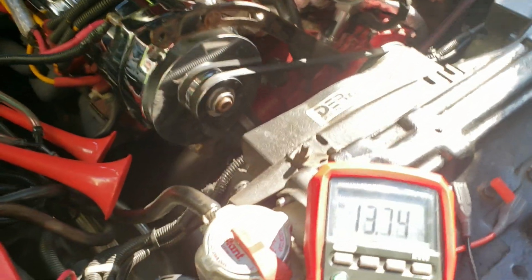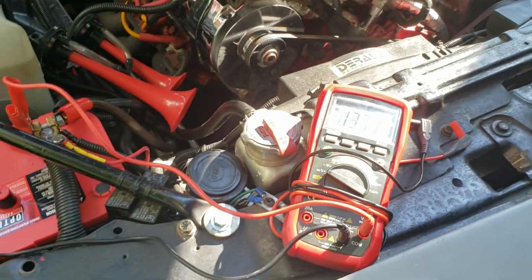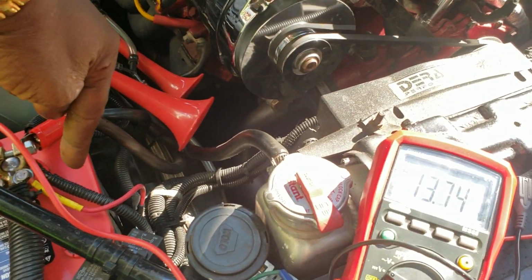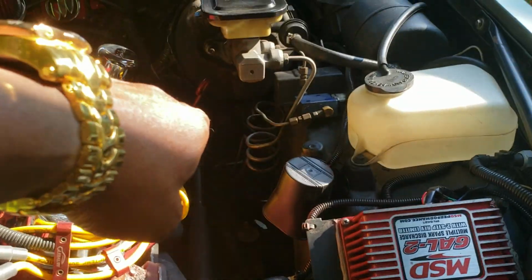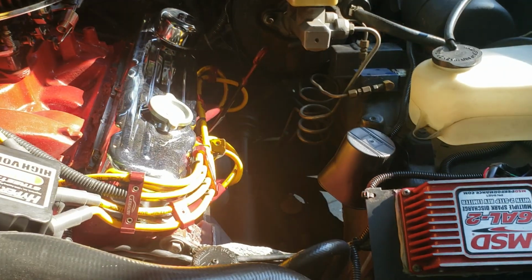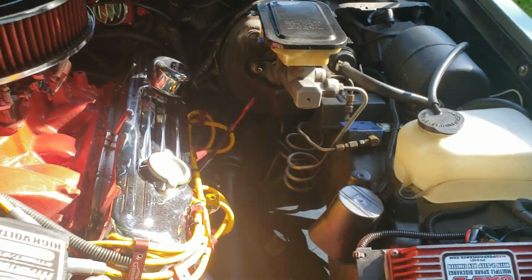That's it. This is over. I've been out here. Now I see some liquid. I'll check that out after the video. But I've been out here with this today for over 4 hours. I completely rewired. Notice the gauge. I completely rewired the electric fuel pump switch, ran it through the firewall, through the grommet. It's safe, perfectly done, absolutely correct at this point. And so far so good.